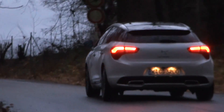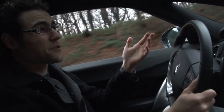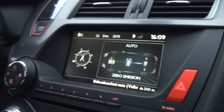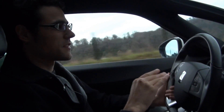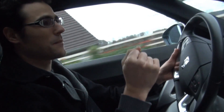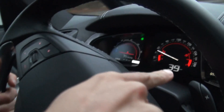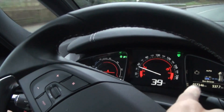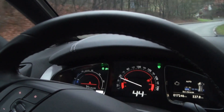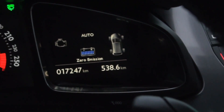We're in the countryside now — you might wonder if you can use the electric drive here too, and yes you can. Going downhill, I can just let the car flow without braking at all and we still get slower. I press the throttle very slightly just so the diesel doesn't kick back on. I'm back on zero emission, and as I go downhill I'm also filling up the battery. On the small screen to my right, blue dots show whether the battery is filling or emptying. Right now the battery is filling as we go downhill. At the bottom of the hill, the battery is totally full again.